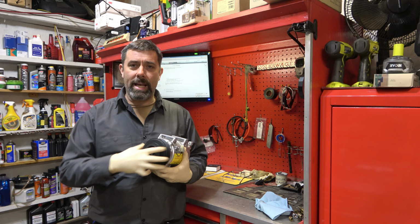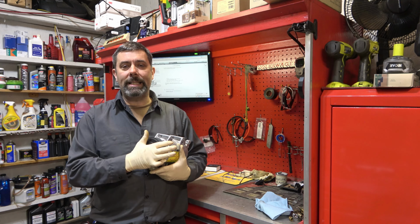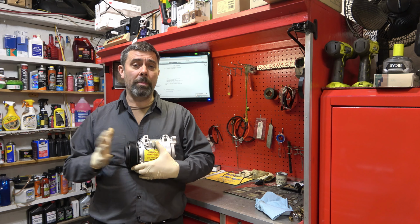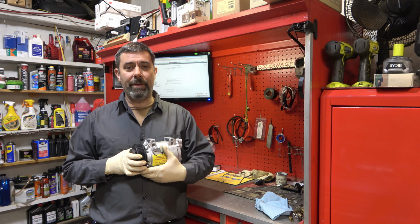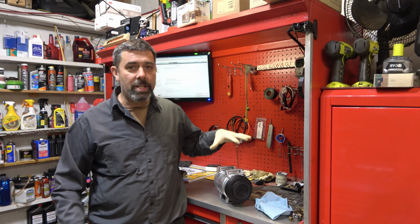And you can take the clutch off of these things with some special tools or a lot of prying and pull some shims out, put it back together again. That is called the clutch overheat problem, where these clutches get so much of a gap that when the compressor warms up, it just cuts off. And so the system is totally fine. It just has too much of an air gap between them. You can pull shims out. Here's the thing. It's quite a bit of work to do that. There's also some cheats that I've done over the years for customers just to save them some money.